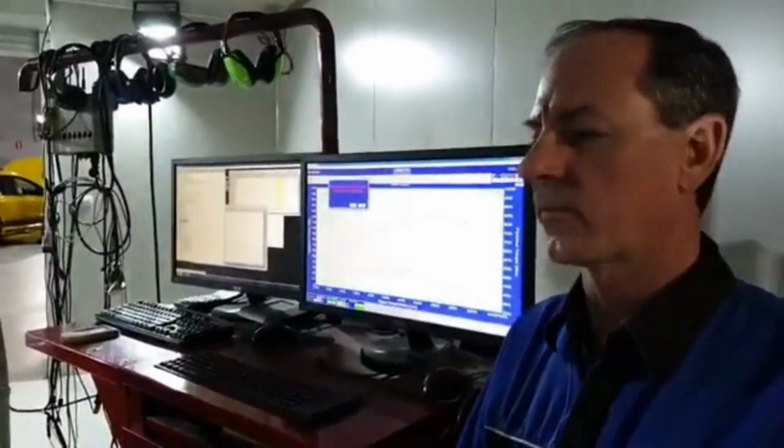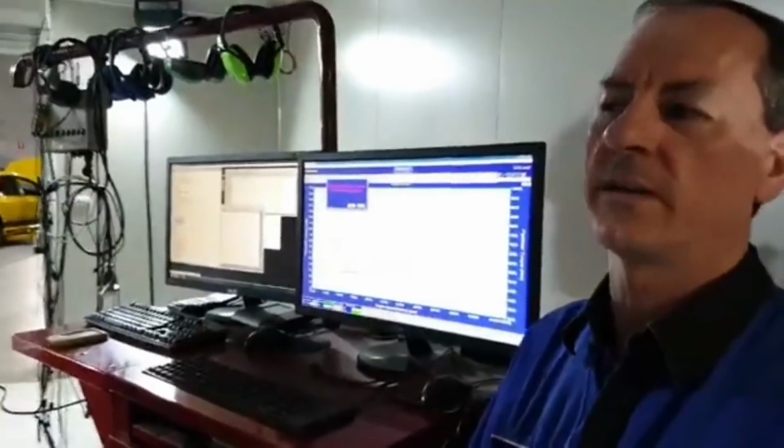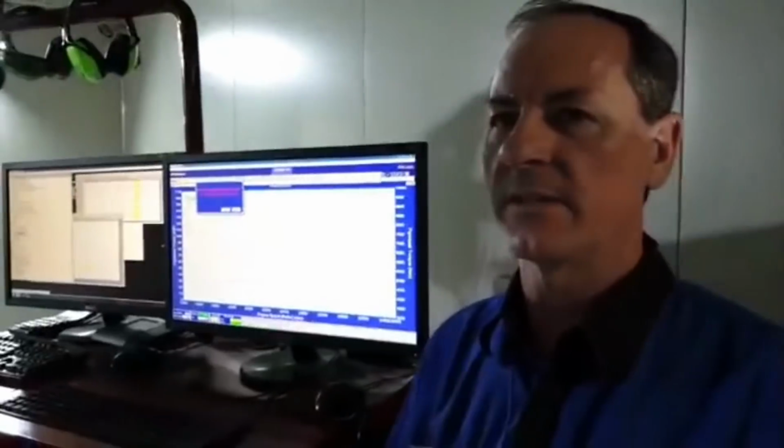Okay. Next one, have you seen better fuel economy? Very good question. Yes. Look, we've seen fuel economy better itself by anywhere from a heavy laden vehicle doing half a litre to the 100 better, up to 2 litres to the 100 better. Prime example is a Ranger with a canopy on it. It's basically got a windsail hanging off the back of it. Even in that case, we've seen fuel economy go down from about 17 litres to the 100 to 15.5, thereabouts.